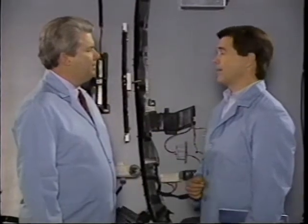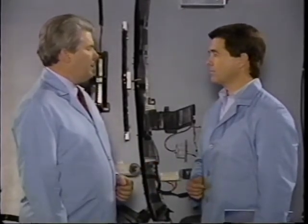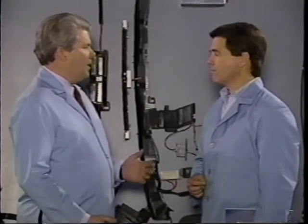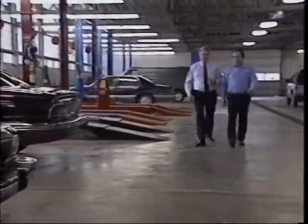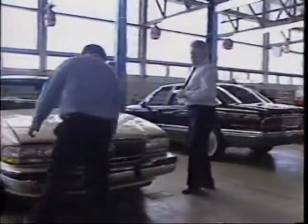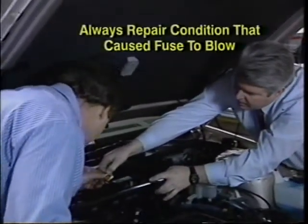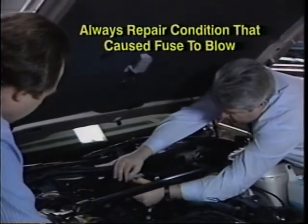So you just jump right in and start fixing what you think is the cause? Exactly, and then you tend to overlook some of the diagnostic steps. Buick Service people see it all the time when they go into dealerships to look at cars with ABS or traction control problems. I know that technicians sometimes resent it when a factory guy shows up and finds that the cause of the condition is something simple. It might be a loose wire or connector, maybe low battery voltage, or even the most often overlooked component, a fuse that's blown because of a wiring problem. Something as simple as checking a fuse first could save you a whole lot of time and money, and it only takes a few moments.